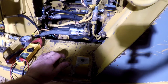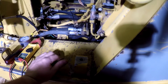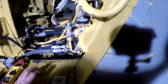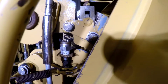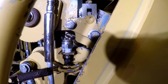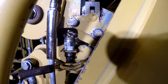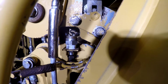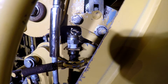it can be a challenge to try to troubleshoot and figure out what's going on. But especially on something that's got a computer on it, which this does not. If you get something that does, and especially you get into those 5-volt circuits and all that, it turns into more of a nightmare. But so I guess I will try another switch here, and if the new switch doesn't fix it, I don't know, maybe I could put a relay there in order to ground across, because this switch is working, it's just not passing the current.